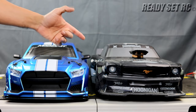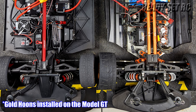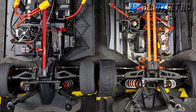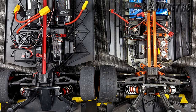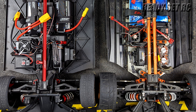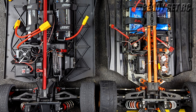Let's take the shells off and let you guys see what they look like underneath. The tires on the EX07 are a little bit taller. The shock bodies are about the same size — both are oil fill, screw down, and adjustable. We're looking at pillow ball suspensions on the Model GT, and multiple adjustments for the shocks on both cars, as well as sway bars on both cars. I did swap out my servo on the EX07 — it was way too slow. I'm still running the stock Surpass system in the EX07.